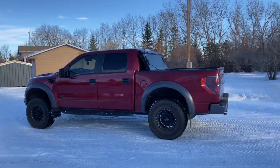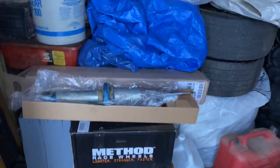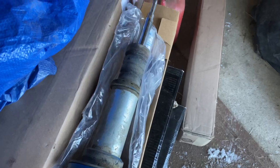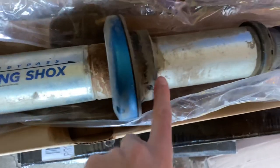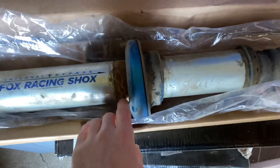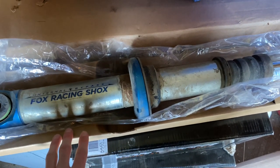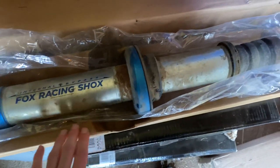For those of you that don't know, these are the factory Fox shocks — these are my original ones. As you can see, I had it set to the mid perch originally. I decided to put all new ones in. Basically there is a ring in here — I was on mid, and then there's another one. You can adjust these. Ford and Fox Racing make these shocks so you can adjust them. This is the mid perch. I was really happy with mid perch, ran it a year, really great. I just wanted a little bit higher. It was a little bit of a rake look with the mid perch, and I wanted more level, more of that pre-runner kind of look. So I did the top.